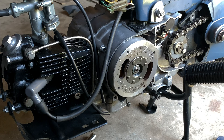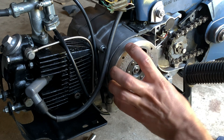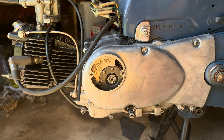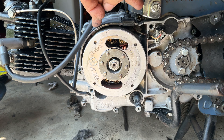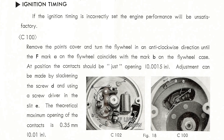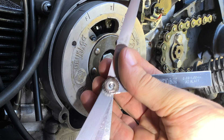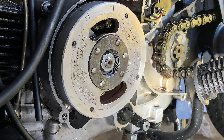Welcome to the setting the point gap timecode. Rotate the flywheel counterclockwise so the F mark lines up with the index mark — F means fire, like spark. The index exists on the service panel and on the engine. We're going to use a .0015 inch feeler gauge — that is super thin, even for feeler gauges — and measure how wide the space is between the points at the F mark when it's just opening.